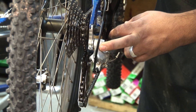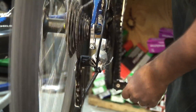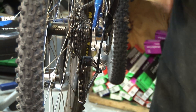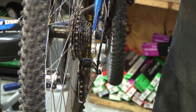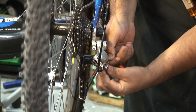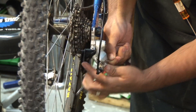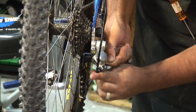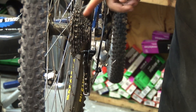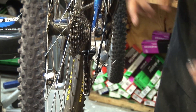One way to find out what type of rear derailleur you have is to shift your gears. I'm going to stop in the middle and come back to release the tension on the cable. I'm going to unscrew this and get rid of the tension on the rear derailleur. When you do this, it should drop the chain to its natural starting position, whether that's the top cog or the lower cog.